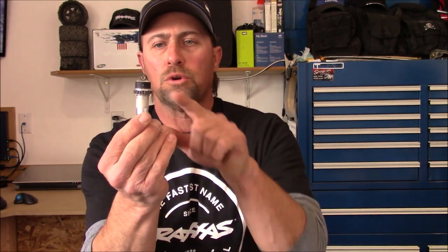Our next step is to turn it over, take this end cap off, and drain all the oil out. You can drain your oil out into anything you want - some people use caps or old pop cans. I use this little tin dog dish thing; it works great. I would not recommend just taking the cap off and dumping all your oil directly into a trash can.